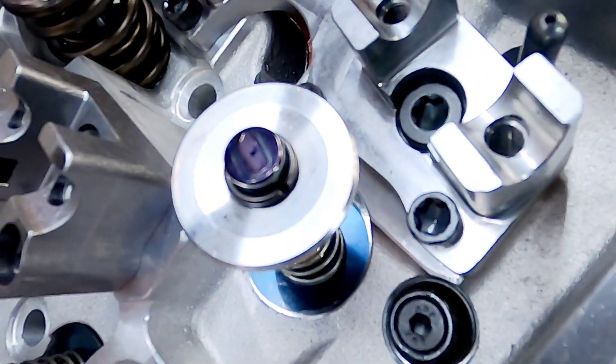I hate to use a lash cap, but it's perfect. Everything has been taken care of — pushrod length checked, pushrods ordered, and hopefully they'll be here in the next day or two. The geometry on this thing is going to be spot on; I wound up having to run a lash cap to get everything in check. Something I'm very impressed with on these heads: the geometry is set up through the stand height. Most shaft rockers I've dealt with — whether Jessel, TND, or anything else — I've always had to shim the stands to get the valve train geometry right. With this setup, not a problem. It bolted right on, and only thing needed for the lift cam was a lash cap. It's going to turn out perfect.